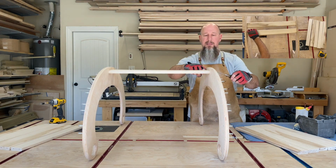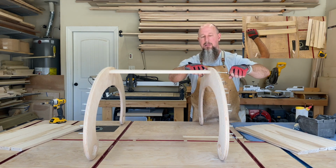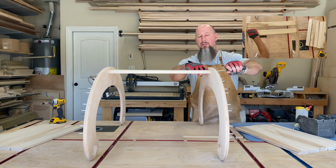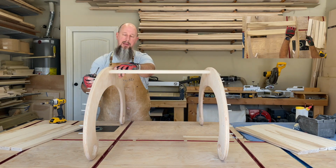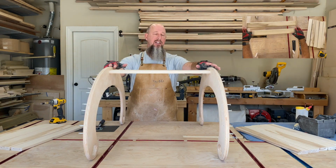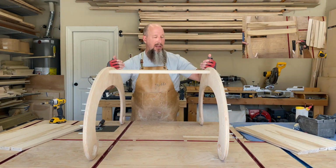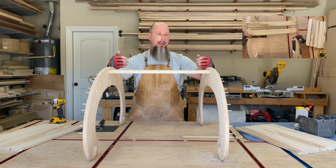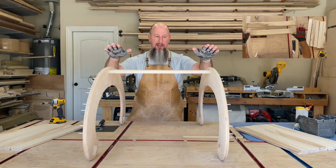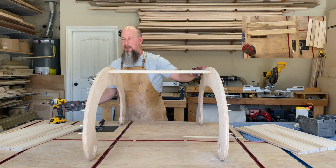Again, same thing on this side. Even though I started with this side hitting it, I'm still just going to drive those in just a little bit to make sure that I've hit inside of where that hole is going to be. Then we're going to go ahead and tighten each one of these down. And I'm going to repeat that process every other side as we move down. If you're a musician, kind of like tightening a drum head, we want to rotate this so that your rocker arch stays completely level all the way through this process. Okay?